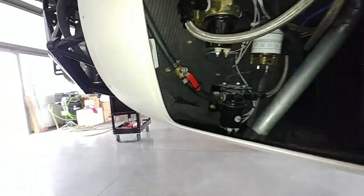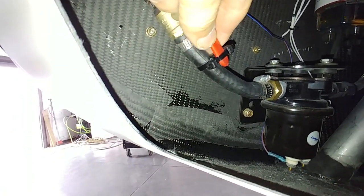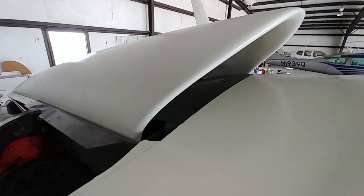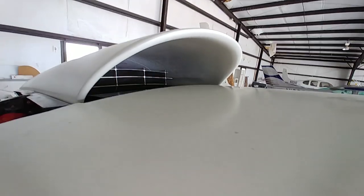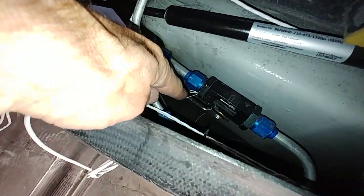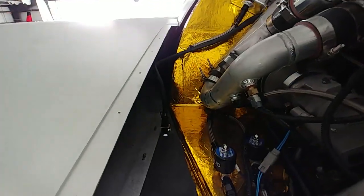Next, working through these little projects — I've just gone and cable tied that little valve there, which is the main fuel valve coming from the fuel boost pump that goes to the engine, so it won't accidentally vibrate shut. And back in the cabin, I've safety wired the arms on these two fuel cutoff valves — these are the ones that go from the strake tanks into the header tank — so they won't accidentally close with vibration.